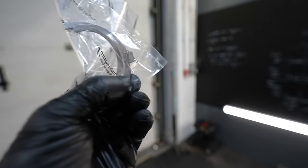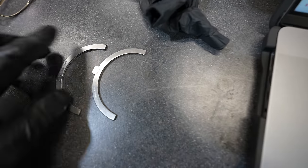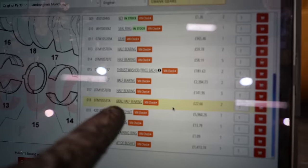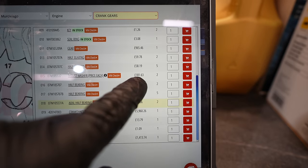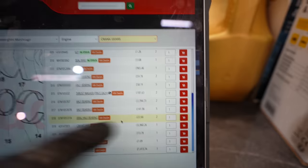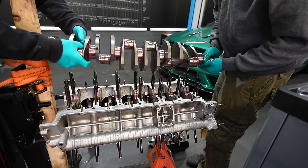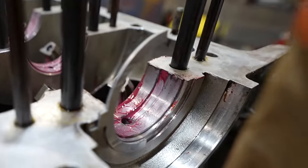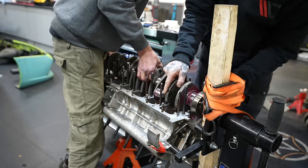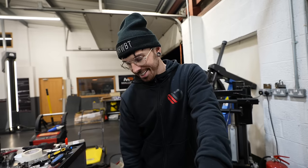So why would someone grind the tab off? Here's our theory: whoever rebuilt this engine before put the crank in with all the pistons, then realized they'd forgotten to put the thrust washers in. The thrust washer with the tab on it can't be slid in without taking the crank back out — there's no way to maneuver it into the recess with the tab on. That's unless you grind the tab off, and then you can slide it around the recess. Pure genius. So this morning we went to Lamborghini to pick up proper thrust washers with the tabs intact. The correct one with the tab is only 22 pounds 66p each, whereas the one without the tab would have been 181 pounds 63p each. That said, the genius who rebuilt the engine before could have just bought the cheap tabbed one and ground it off.